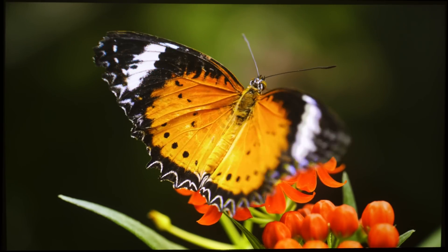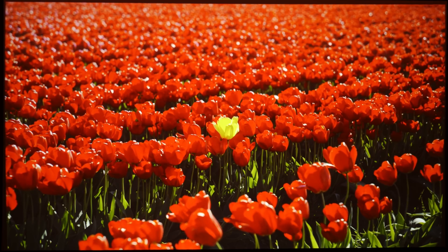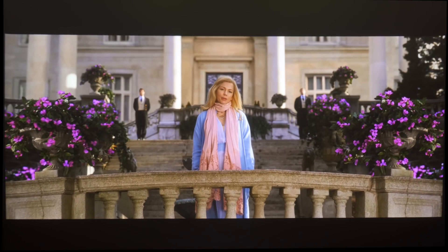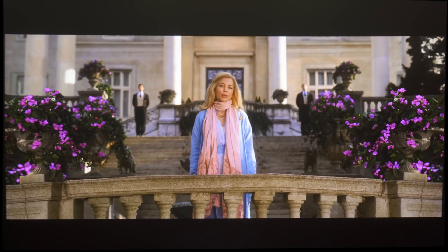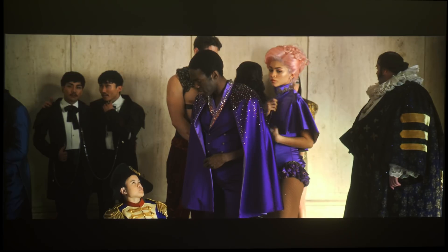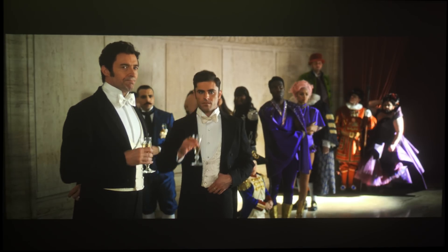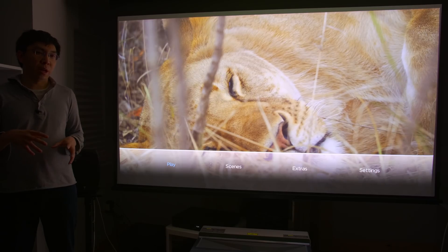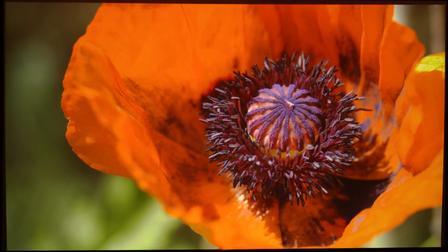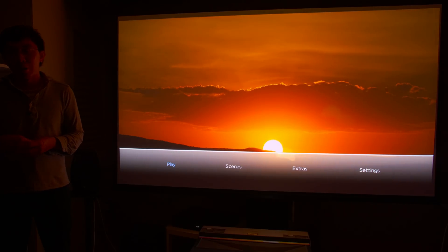This just gives another dimension to the HDR presentation. When I watched HDR clips from Spears & Munsil and other wide color gamut content, I get this pop and vibrance that I've never seen on any other ultra short throw laser projector, and the picture is extremely bright. When I reviewed the Epson LS500 recently, I mentioned the picture is bright, but it is not as punchy as this Hisense H100LDA, because this Hisense projector has a higher ANSI contrast and also the wider color gamut increases the perception of color luminance. This is known as the Helmholtz-Kohlrausch effect — I'm not sure I'm pronouncing it correctly.